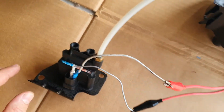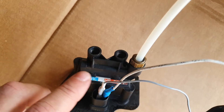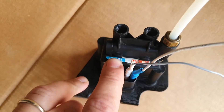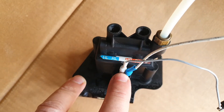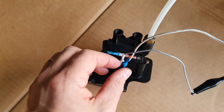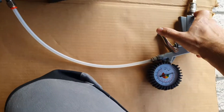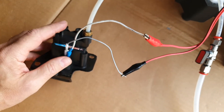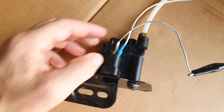There are three different ports on the valve block. The compressor port, marked P, is always open — I've connected my compressor here. The second and third ports are normally closed: the one on the right feeds the red pipe going to the right side of the car, and the blue one goes to the left. There is a connector on this valve, and you can use a 12-volt supply from a battery or a transformer to test it — connect it here and turn it on to see the valve opening.